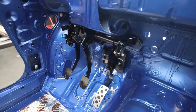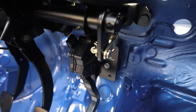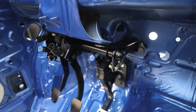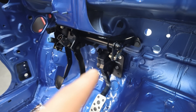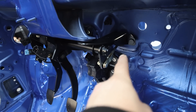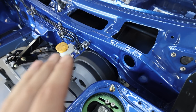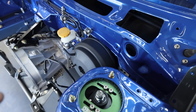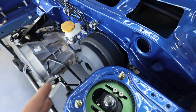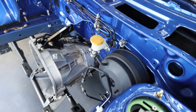Starting on the inside of the car, we have our pedals in. The rods that come through the firewall have little retaining clip guys — when you push the pedal, it actuates the arm and moves the cylinder. We have those hooked up for the brake and the clutch. The clutch comes up and uses a long rod in the middle to actuate it. Up here we have our brake booster in, which has been Cerakoted and still has about a three-day cure time, so we're leaving that alone. We have an STI clutch master, so that can stay on.